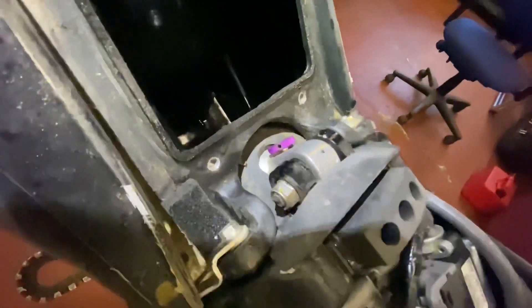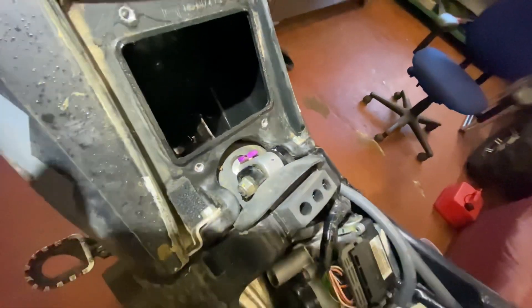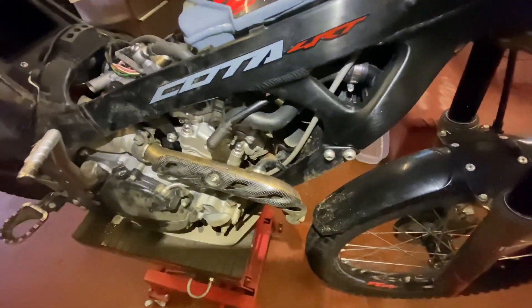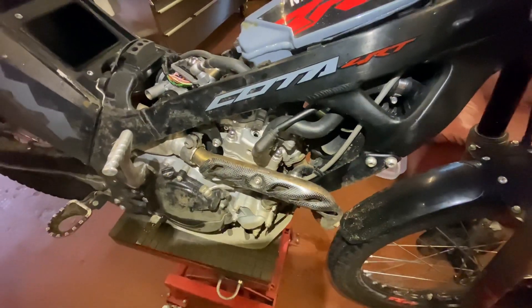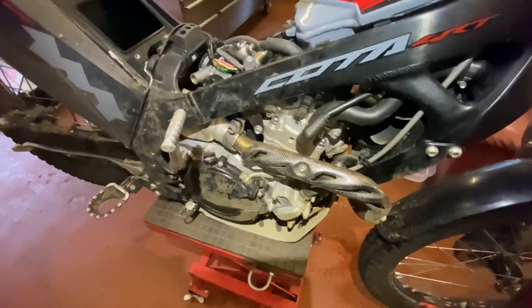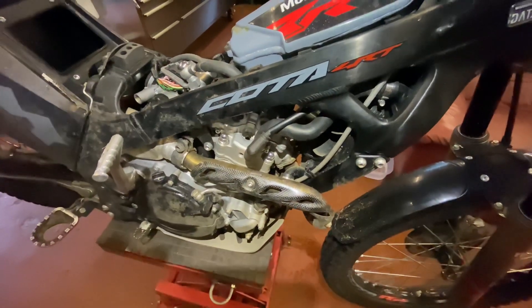You can see a little bit there. The bike won't work — it's lost spark and it seems to have lost compression. I don't know if a bit of paper might be holding open one of the valves, one of the ports. It looks like we're going to have to strip it down and find out.